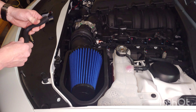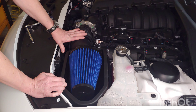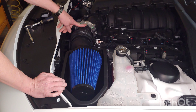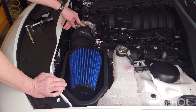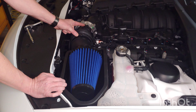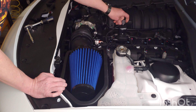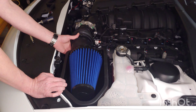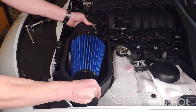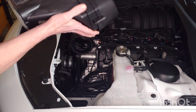A catch can install is something we're going to take care of in the near future. Now, I've already loosened these hose clamps. I'm not going to take it off the throttle body because on these newer model vehicles, I'm pretty sure they glue it — it really seems like it's glued. We'll take this clamp off because we're going to be reusing the stock air rubber. Go ahead and get your intake air temperature sensor connector and keep it out of the way so you don't damage it while tugging and pulling, because this is kind of a tight process. Then the air box just slides right out.